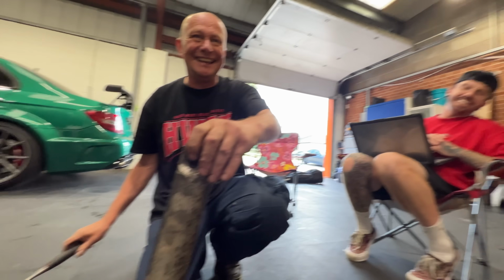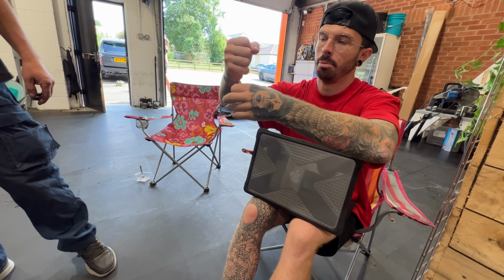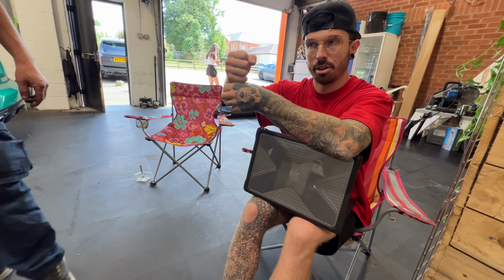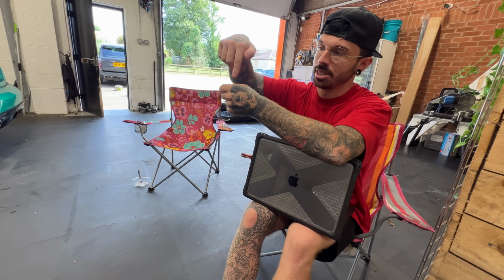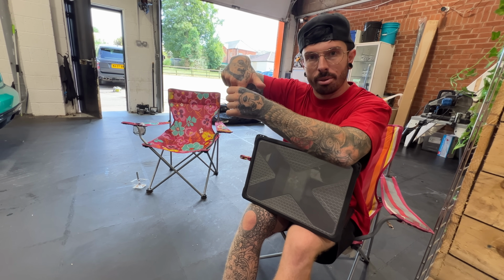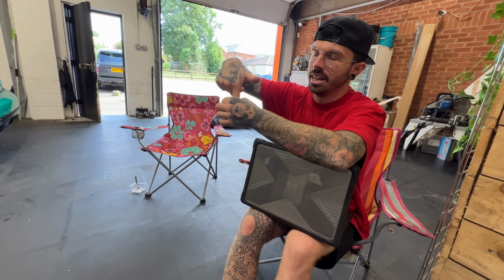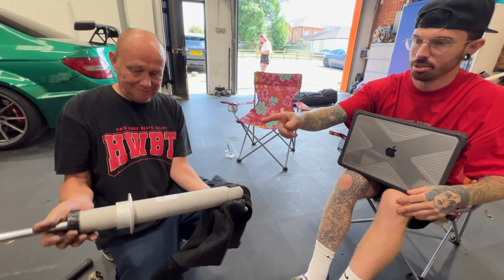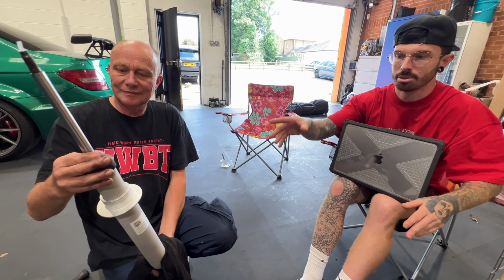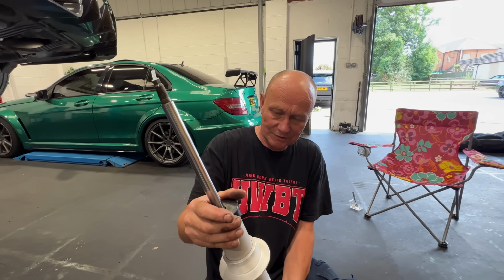Got it off. We think the seal actually leaks because normally on stock suspension, that shaft in the middle will be sitting on the regular seal in the same position. But what we've done, after we've put the lowering springs on, the shaft is sat lower, so the bit it's sitting lower on has upset the seal and it's just weeped out of it. But this one shouldn't do that now because it should be used to sitting in the position that the KW ones do, I think. Talking rubbish. No, I think that's why I did it.